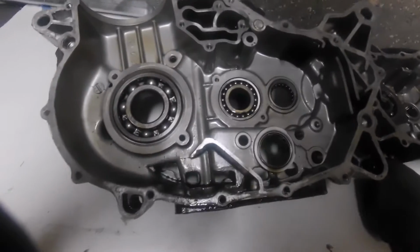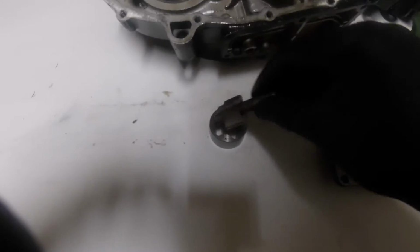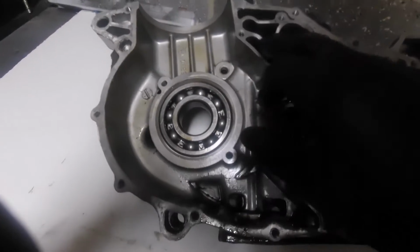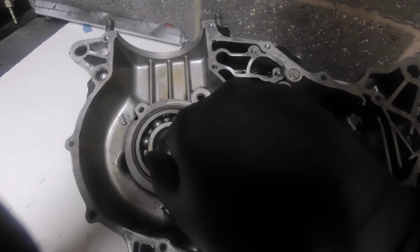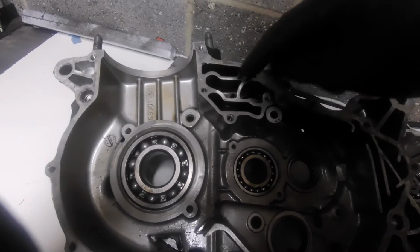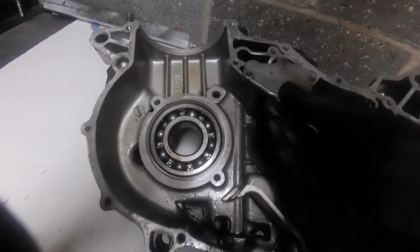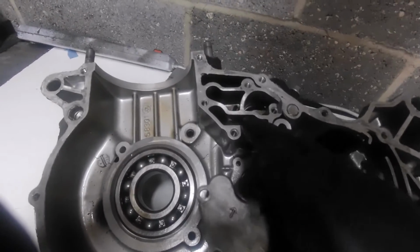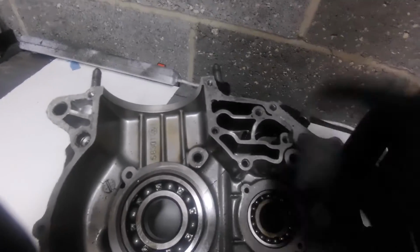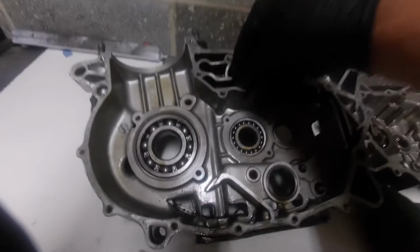That's the first part of it, the big pump, if you like, which is this one. Okay, this pump. That's that. So we now know that the purpose of this little port, this little shape here, is to feed oil into the pump. And we now know the area here that's covered up by this plate, when it's on with the arrow up, because obviously that seals it and makes each one a separate chamber. So there we go again, into the pump, out of the pump to here and out. I'm going to come back to that side of it in a minute. So there's the actual scavenge side of it.